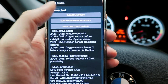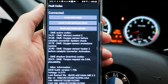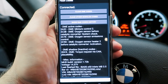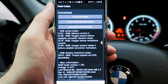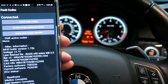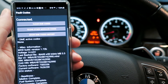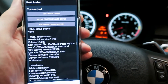What I want to show you is: when you clear your check engine lights — even though I don't have one lit up on the dash, I have pending codes — if you clear them while the car is running, the car will go open loop for just a split second and disregard the oxygen sensors, then go back to referencing them. That's a good way to confirm if you have a bad oxygen sensor because you're forcing open loop. I'll show you right here — click clear — you'll see how the car smooths right out, and then it's like, wait, okay I'm warm, let's go back to referencing the sensor. Boom, it's bad. Clear again — smooths out — and then boom, it goes back to rough because it's back to referencing the oxygen sensors.